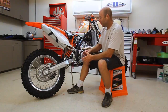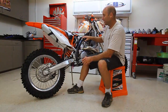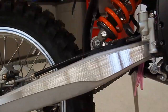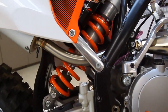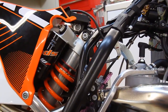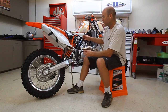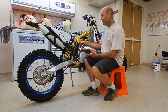This is the 300 XCW. It's a new chassis for this year, but last year this was on the XC's. It's the linkageless system, and what they've done is isolated the upper part of the shock where it mounts to the frame away from the main backbone — that's the key to the new PDS system. It's very similar to the way they're mounting the link shock, but if you look closely up in this upper area you can see how the mounting point is a little bit different because it's throwing a slightly different amount of force up into the chassis.